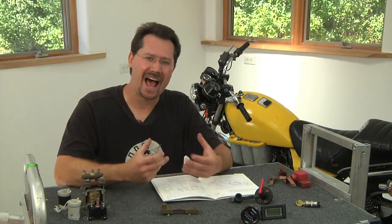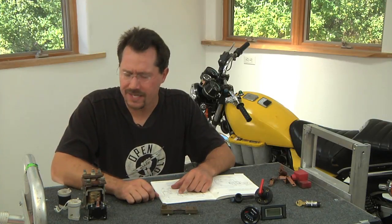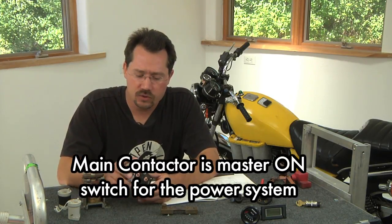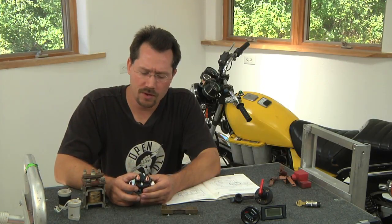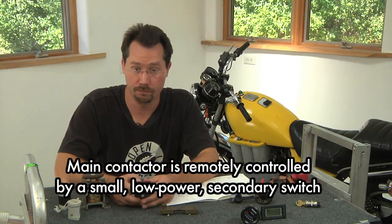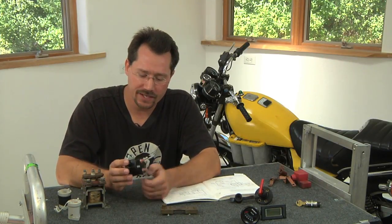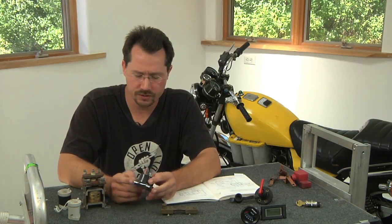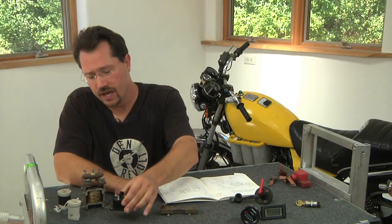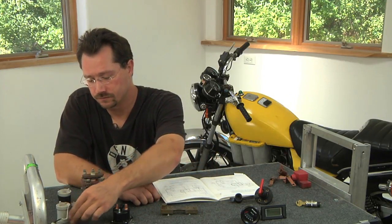The main contactor is kind of your giant on-off switch for your entire system. I've got a couple of different types here — a range of styles and sizes. The main thing is it's an on-off switch where your battery cables connect to the two main power connectors, and the two smaller connectors take a lower amount of current, sometimes even a different voltage. For example, this one takes 12 volts through the two small connectors to complete the circuit between the two big ones, even though the circuit on the big ones could be something higher than 12 volts. This style is sealed up, resistant to corrosion, and has bolt holes to mount it down — this is the style I'm going to use in the motorcycle. Another style here isn't at high enough amperage rating for the motorcycle.